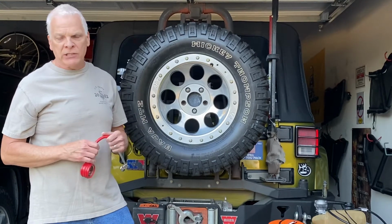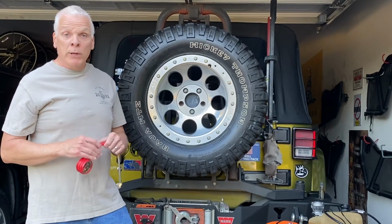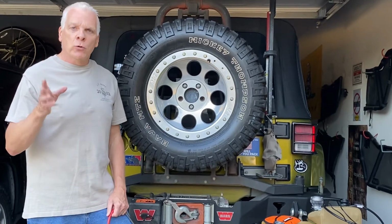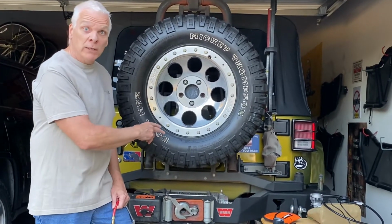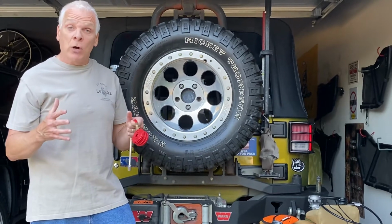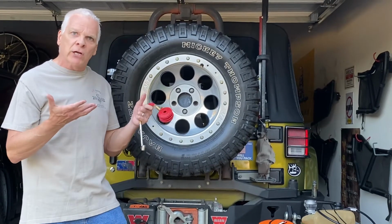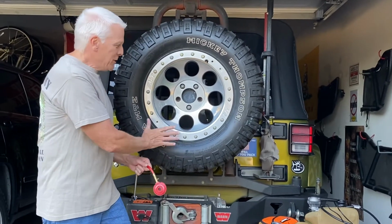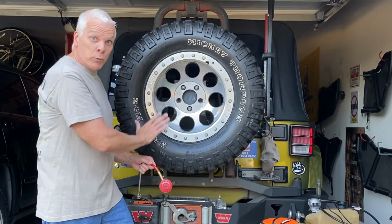You don't need that kind of stuff. What we would do back in the day, little tip for y'all, we'd carry a can of hairspray. And as corny as it sounds, if you would de-rim your tire, it's impossible, right, to get it back on. Well, what we do out in the field is we jack the vehicle up, take the can of hairspray, spray it into the empty tire, and you got the tire at least on the rim, you push it back in